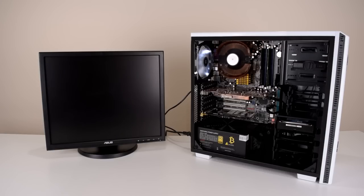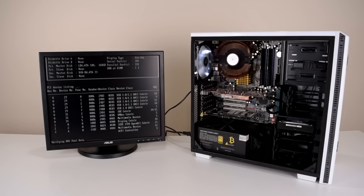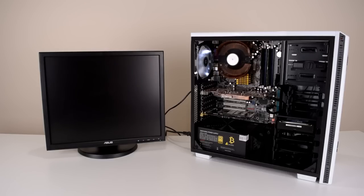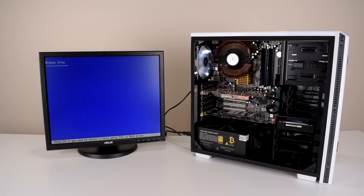We've got 2 gigs of RAM and it should also pick up the hard drives very soon. I had to swap out the hard drive — the 500 GB Caviar Black didn't get picked up, so we're using a 160 GB also from Western Digital and that's working fine. I'm booting off the optical drive now with the Windows XP Service Pack 3 installation CD. I'm going to install Windows, the drivers, some benchmarks, some games, and we're going to check out what this machine can do.